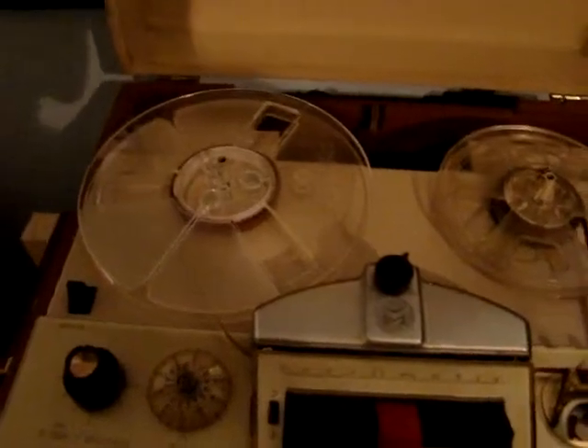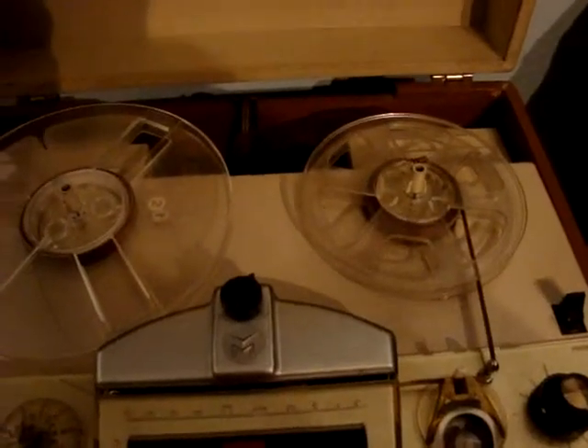When I found it, I played it for some time. When I found it, the tape had snarled and was wrapped around the capstan. This is what's left of the supply reel of tape — this little reel here. That was the amount after the snarl. It was all wrapped up on the capstan, and that just pretty much fell apart right there. I'm going to splice this tape back together if it's worth it. This stupid Sony tape has the sticky shed syndrome type of thing — it's the oxide coming off.